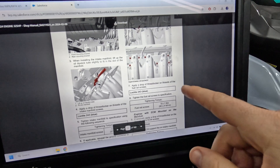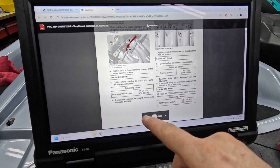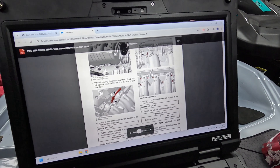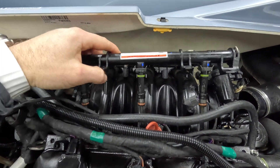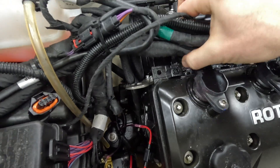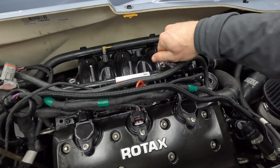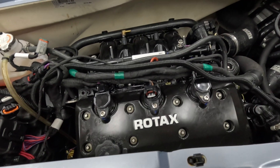This is the torquing sequence and spec. You work from the inside out to spread the gasket. Torque these to 11 Newton meters — I'm going to do 11.5 to get some extra clamping force. I'll post this graphic so you can see the torque sequence for yourself. Intake manifold is bolted on. Next get your fuel rail back in — the injectors will line up and there is a gasket on them, so get those seated and push in on each one until the whole rail is snapped into place. There is a torque spec for these bolts but it's nowhere near as important as the one for the intake manifold.